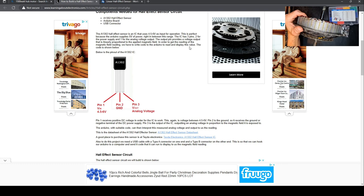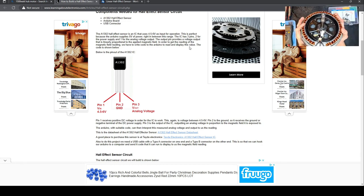We're not dealing with them today. I'll do a throttle replacement sometime. It's cheap and cheerful. But these are switching hall sensors or bipolar hall sensors. We'll go through the models, etc. But pretty much any bipolar hall sensor will do in these hubs. Also for PAS sensors, but PAS sensors are so cheap, there's no point swapping them out.